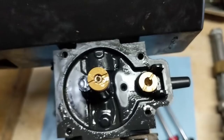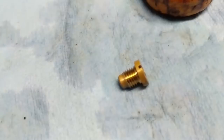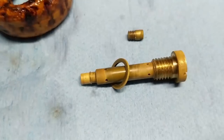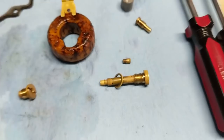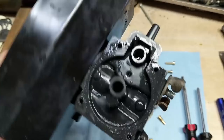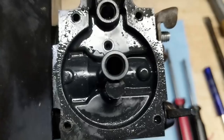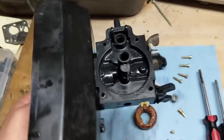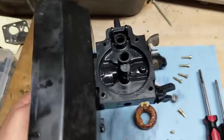Our seat has now been removed. Something to mention: some of them are going to have a washer required underneath them — the kits I have come with a small plastic washer. I also have the main jet here, and the distribution tube has a little brass washer, so be aware of that. I've also removed the bowl gasket, which I'll be replacing. If you don't have an ultrasonic cleaner, you can use your garden hose — these are plastic carburetors and they're easy to clean. What you don't want to do is put one in a dishwasher because heat can warp the plastic. I'm going to use my ultrasonic cleaner with some lukewarm water.